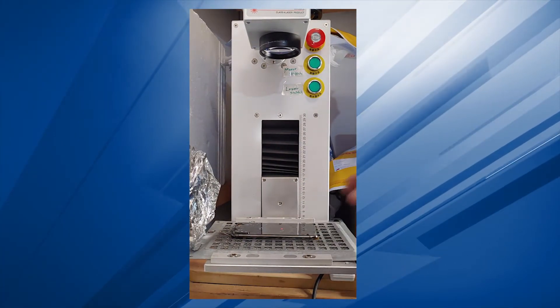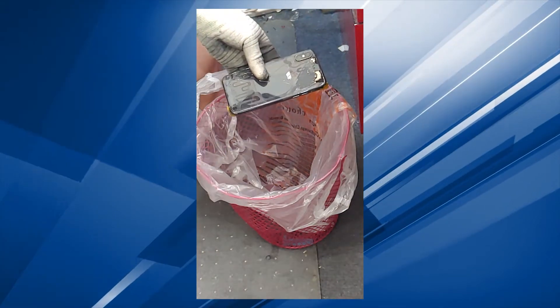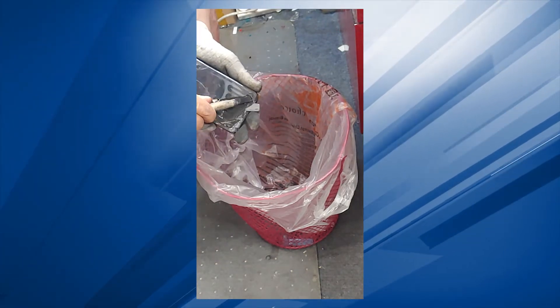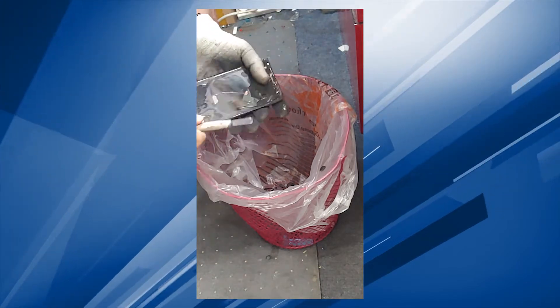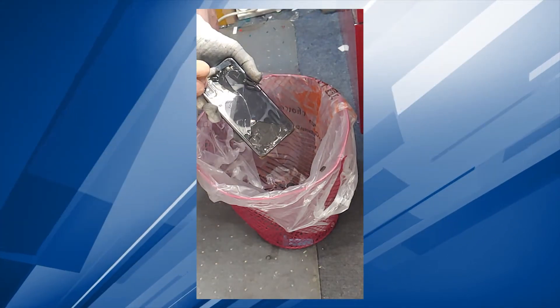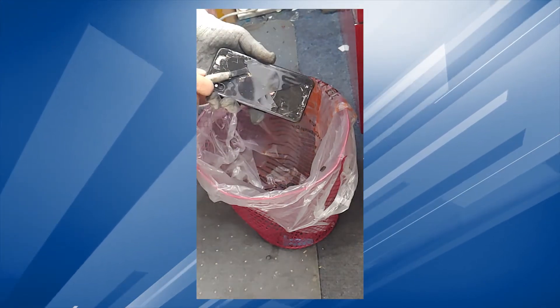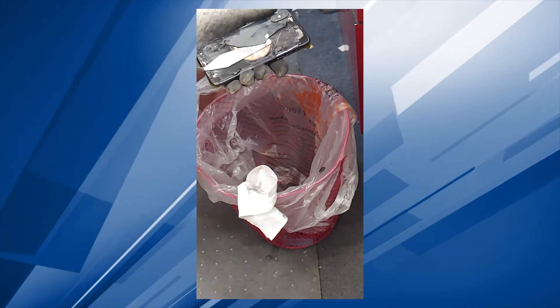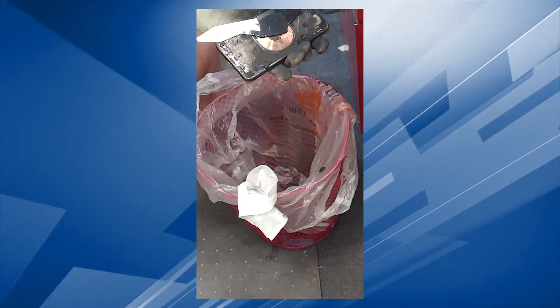This is almost done — we're going to the next step. You can see those squiggly lines? Those are the adhesives that have been pulverized by the laser. We still have to scrape the glass off the main housing. We're going to dump it over to the bin slowly but surely. Although hard to believe, this is actually the easier way — if the adhesives are still active and not pulverized, you'll have a very hard time scraping off the glass.